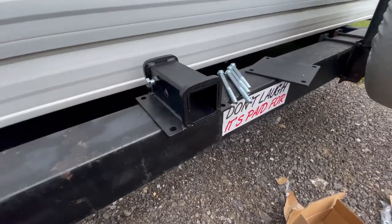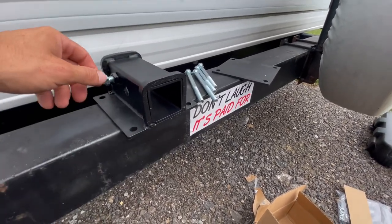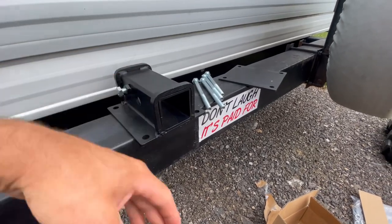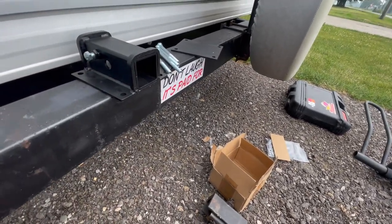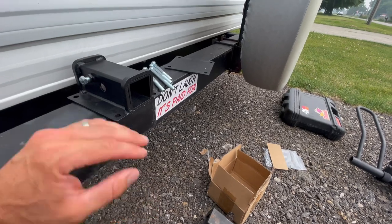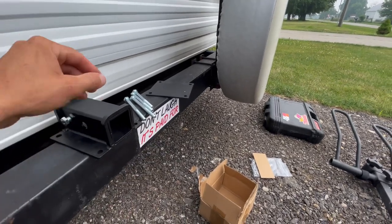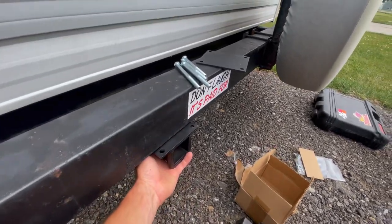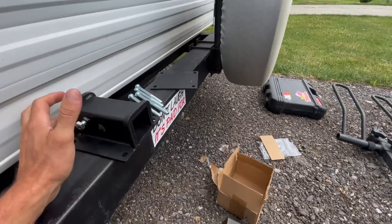This is pretty self-explanatory other than deciding if you want it on top or bottom — and here's why you want it on top. You're at the rear of the bumper, and when you're going over an incline, railroad tracks, anything that might hang up back there, there's going to be more of a pinch point front and back. Going down an incline and back up a steep one — some campgrounds will surprise you — you don't want anything hanging low. You don't want your bikes hanging up, so get it up as high as you can. I'm going to mount mine on top.